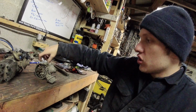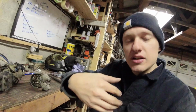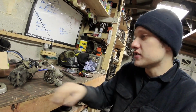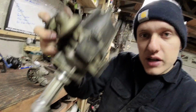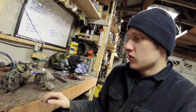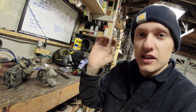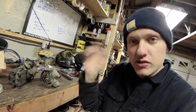It has a long, big wiring harness that comes out of it. Okay, on the driver's side strut tower, there is a box. That box contains the igniters. They're not J109 igniters like these. They're like a J110 or something. They're much bigger. The workings of that distributor are effectively the same as the late model one. Okay, and it's not that hard to convert either of these systems to the late model one. Alright, which I have a video on, which I'll link.